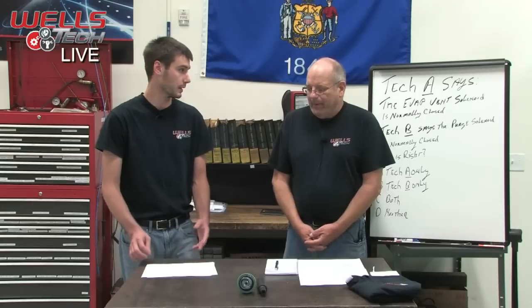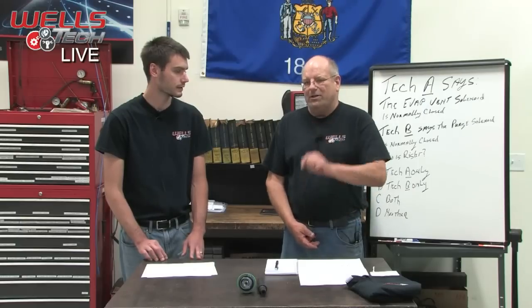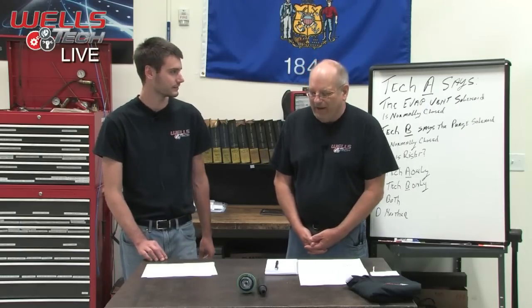It's going to take maybe a few hundred miles to pass that readiness monitor. Yeah, if they think they're going to come into your shop and then go take their emissions test the next day, you might want to give them a heads up and tell them it's a good time to file an extension. Right, yeah. The chances of that are pretty slim.